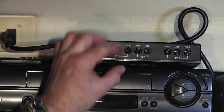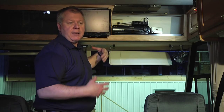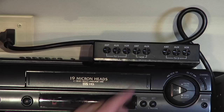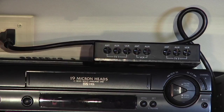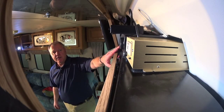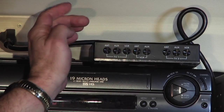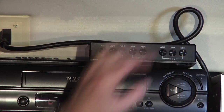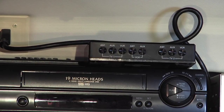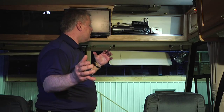The third input is coming off the VCR. The VCR control allows me to go off the antenna — so if I want to record a TV program through the VCR — or I can use the auxiliary input. Same thing with TV number two: I have antenna, auxiliary, or VCR, so that'll take the feed into the back room and I can watch different feeds on different televisions.